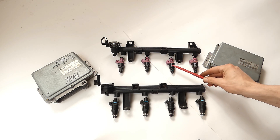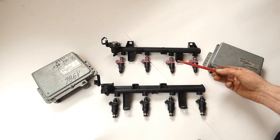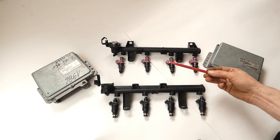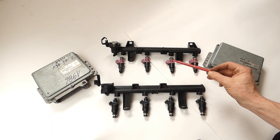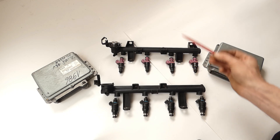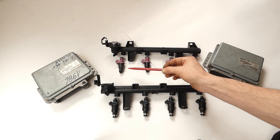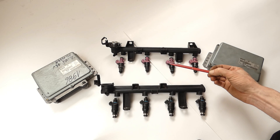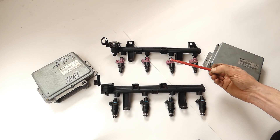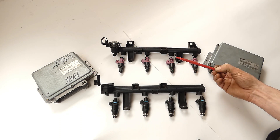When you get the new old injectors, check what they look like - do they already have some damage? I would recommend getting them cleaned. If you have the means to clean them yourself, do that beforehand. I didn't do this myself, in the hope that they would just work. I assembled everything and it didn't inject. Finding the fault - all four injectors were clogged - took a long time. So spare yourself that: clean them beforehand, or get them cleaned, or at least test them first so you know they work at all. If they don't click, please clean them. If that no longer helps, then buy new ones.